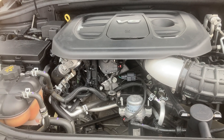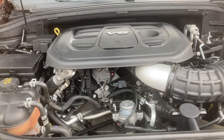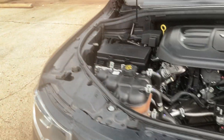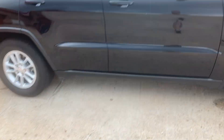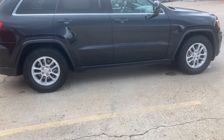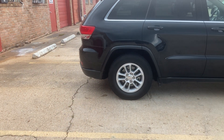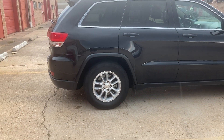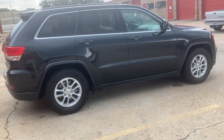Let me know what you think — comment at the bottom. I'll include any of the part numbers I used. I lowered it with a Swift spec arm lowering kit. It was okay — it lowered the front about a half inch and the rear about three inches. But then I had to go back in on the rear and add a one inch spacer to kind of level it out.